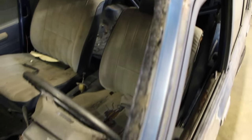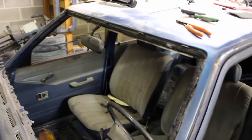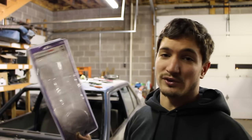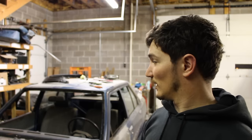Now all I have to do is scrape the old urethane off all the areas around the frame and get all that old stuff off so I can put new urethane in after I'm done painting. That's going to do it for this episode of Builds by Bailey. For roughly $20, we were able to take the windshield out ourselves using the Harbor Freight tool. This is one step closer to having the cage put in — the bars and gussets to the A-pillars. Next step will be putting in the door cards and bucket seat to get everything set for the cage. Thanks for watching — don't forget to like, subscribe, and share with your friends.